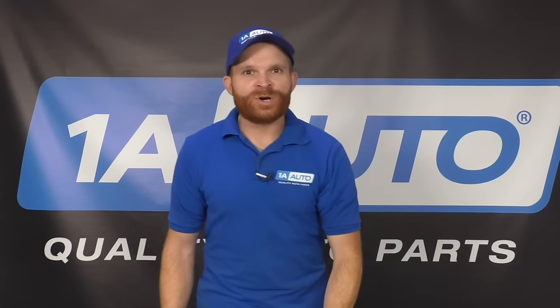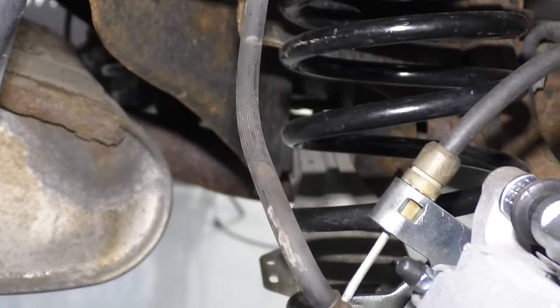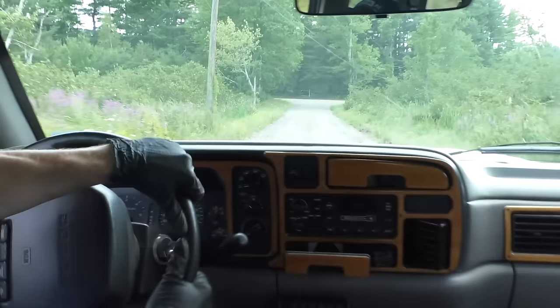If you have a problem with either your front or rear brakes, it's going to put extra pressure on the brakes that are functioning. If the rear calipers are frozen or the sliders have an issue, it's going to put way more pressure on the front brakes because they'll be doing all the work - more work means more heat. Some rear calipers have an emergency brake integrated into them. If you have an issue with the e-brake cable or lever and it's applying constant pressure to that caliper, it's going to overheat. You also want to think about those flex hoses - a restriction in your flex hose can prevent brake fluid from flowing properly, which could continue putting pressure on those brake pads. Some vehicles also have a ride height sensor, generally located in the rear, which senses the vehicle tilting under braking and diverts more fluid to the front rather than the rear to prevent loss of control.